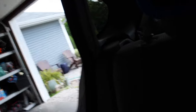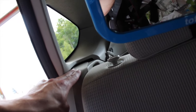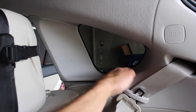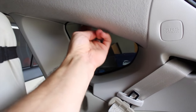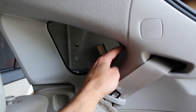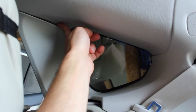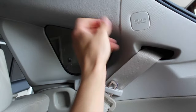Once I was in the upper area, I didn't really want to run it through the crack where the seat belt is. I could have run it through there, but there's an airbag in there somewhere and I didn't want to run out of room. So I ended up going for the side piece, up along the bottom of the window, up to the top. What I should have done is gone up and then over along the top under the headliner — that would have been a bit easier, but you can go along the side if you'd like. You're just going to pull the headliner back a little bit and tuck the wire right up underneath it, pushing it in and tucking it in along the piece. You don't need to remove any of these panels — just push in on the soft part, tuck it in, and let it rest back down.